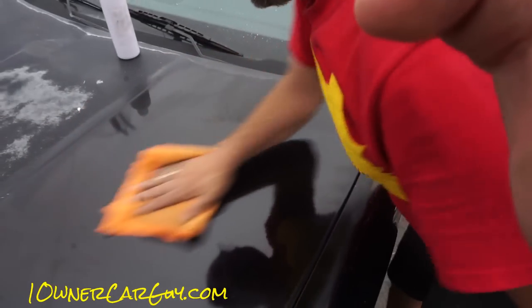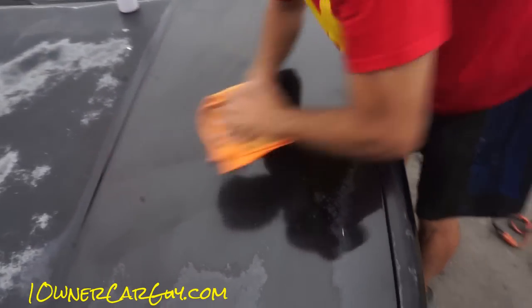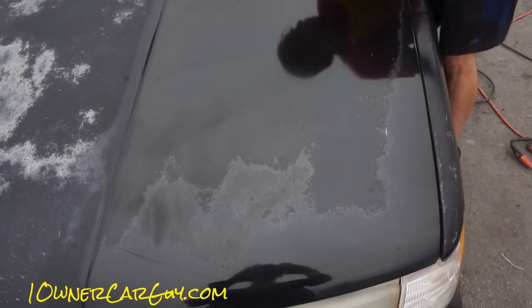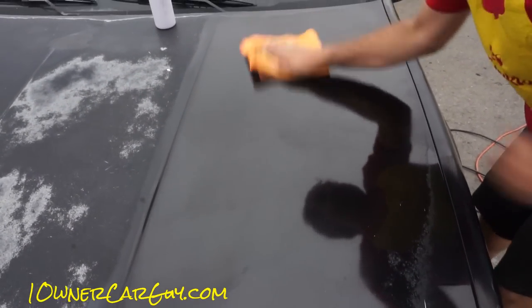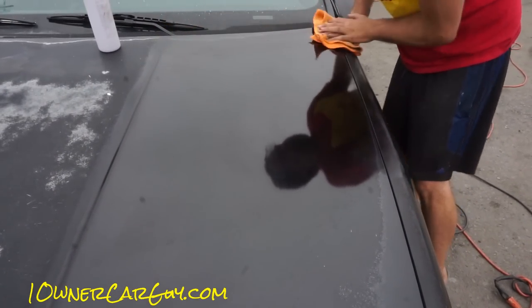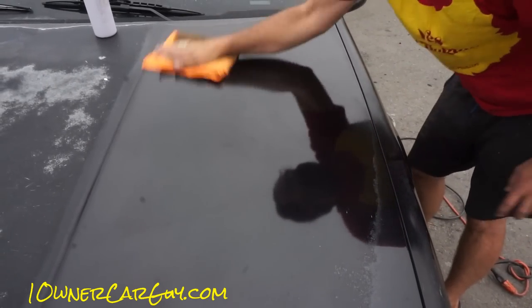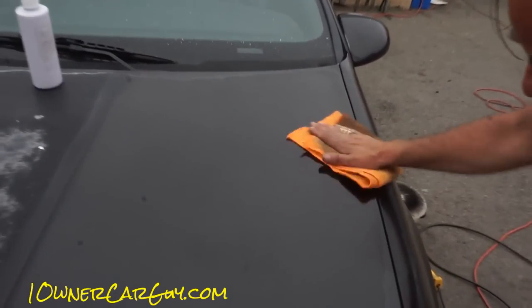Those are imperfections in the paint because grit, sand, grease, and grime has set on there. When you wipe the heck out of it afterwards, it should come out looking damn nice. Keep everything looking good as you go — not only so you can tell where you've been, but so you can tell how it's looking compared to the rest of the car. You don't want to start getting different results and not notice it.